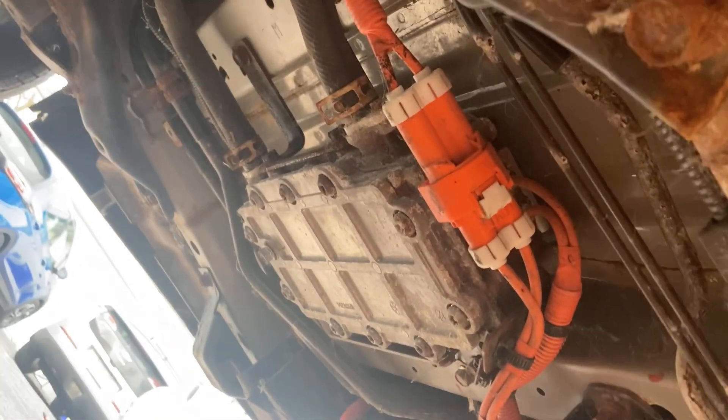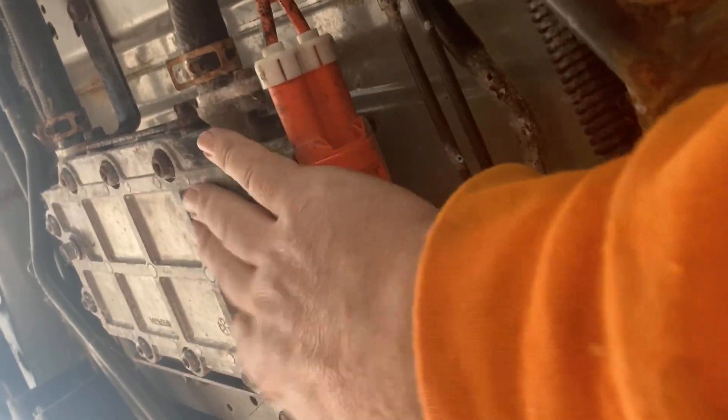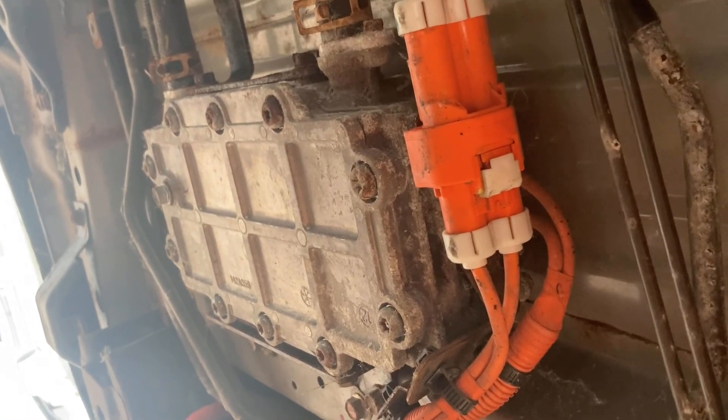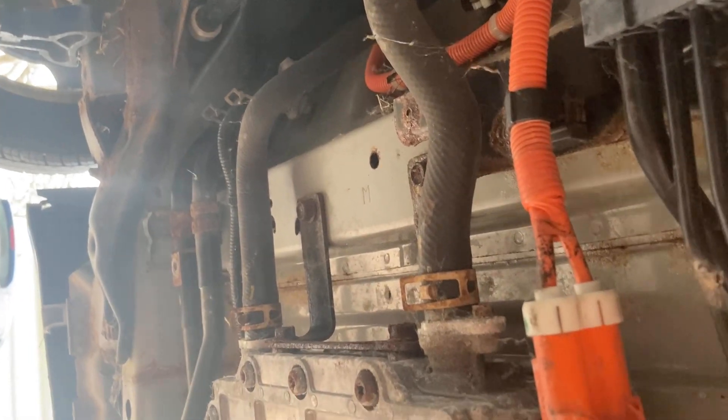What I just wanted to show you is the fact that this is, other than being covered by that plastic cover, completely exposed. So in the winter you're driving around, this is the outside bottom of the car, and this is just letting you radiate away all the heat. A modification you may want to take a look at is just to insulate that - make sure to do something appropriate for going over the aluminum and the radiator hoses.